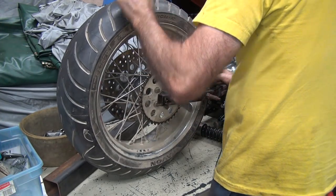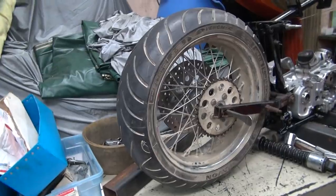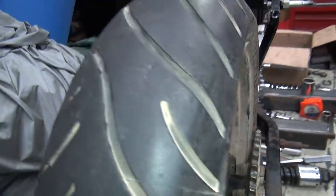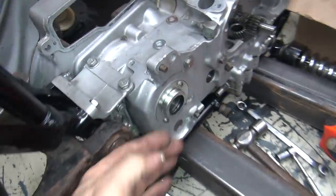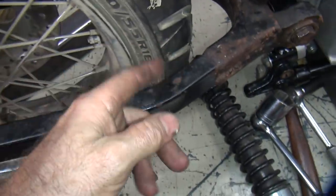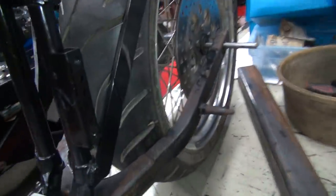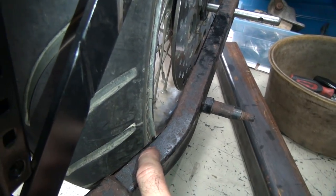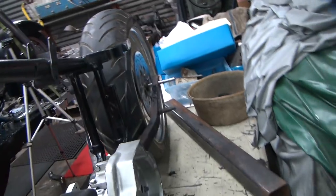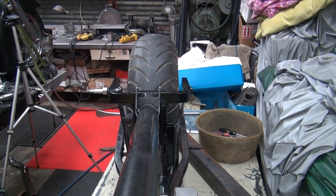Okay, so we're back on our swing arm again. And this one's a little bit tighter. That's a lot tighter. So you can see how it gets right up into the front of the frame up in here. There's your problem, right up in that area there. So if you had an offset sprocket here and you could center the wheel in the bike, you could use this. But there's not an offset sprocket out there to use unless you make it, which I have done in the past. When you offset this tire all the way over to here like I did on my bike to make it clear the chain, you can't run it in a swing arm. If the tire is centered here, it'll fit. And right now it is centered in the frame fairly good. It's a little bit to the left like it should be, but it's good.